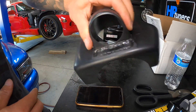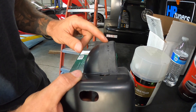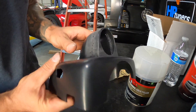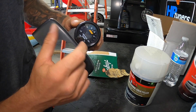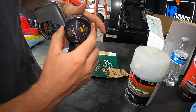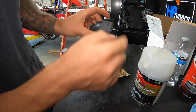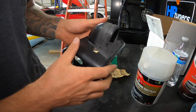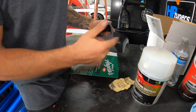Both sides inside and outside plastic welded, strong as heck. After a bunch of sanding this is where we ended up — pretty dang close. I did raise it up just a little bit, not flush completely, because I wanted to make sure the bottom of my gauge was going to clear the bottom there. I needed that room. I've got some bondo here so I'm going to build this little ridge over — just a lick of bondo and fill a couple small divots. We'll sand it and then we should be ready to paint this thing.